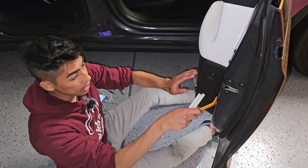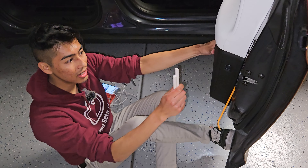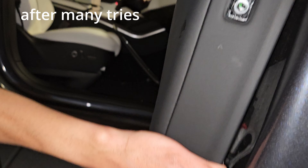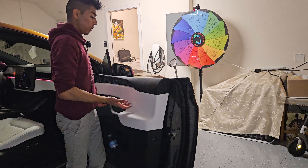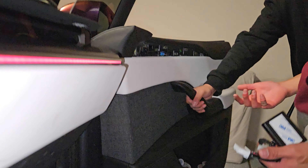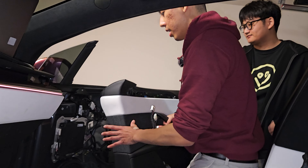Now we're going to take off the inner door panel. Put your pry tool in here — if you can't get it in, use your hand and cup the inside part of it. You can try to pull it out a little bit, put your foot right here, and allow yourself to separate the door a little bit. I took the little sticks that this kit came with and shoved them in between the door, pushed the pry tool up — that gives you a lot of working space inside. Now the door is going to come off — lift it up and then away from the car.